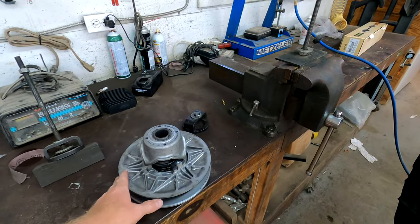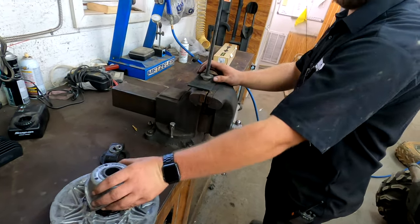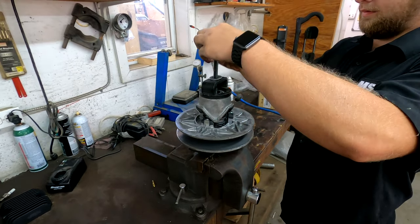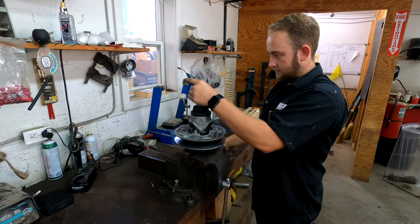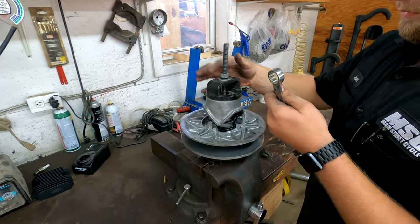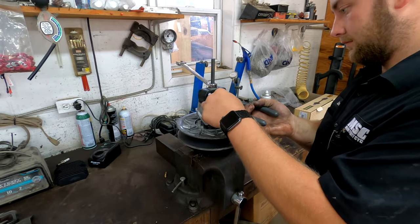So if you get a kit, this is what you're going to have to do. We're going to first show you how to reclock the secondary. We've taken that off, and Joel here is going to show you how to reclock and reposition it. The stock position on the C-Force 400 is B1, and the kit we got from Airdam Clutches — he recommended for this particular setup to go to B3. You will need this particular tool kit; you can get it from EPI — I'll put a link in the description.